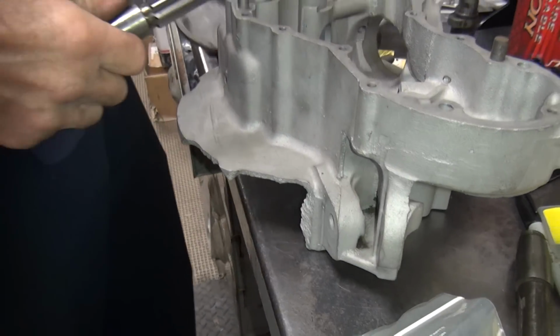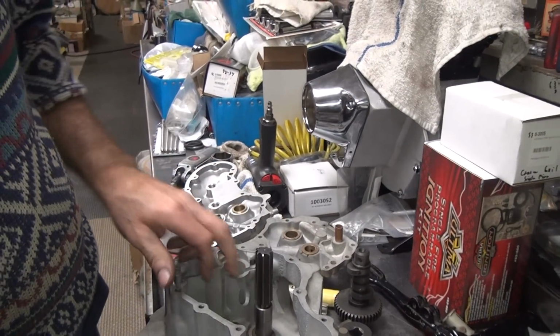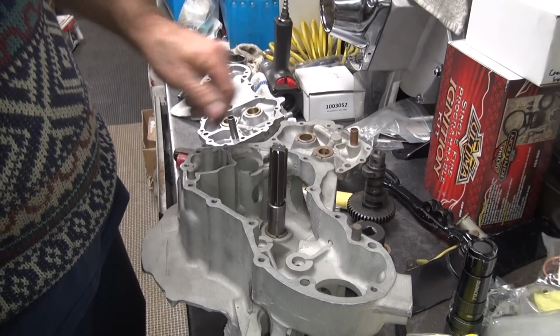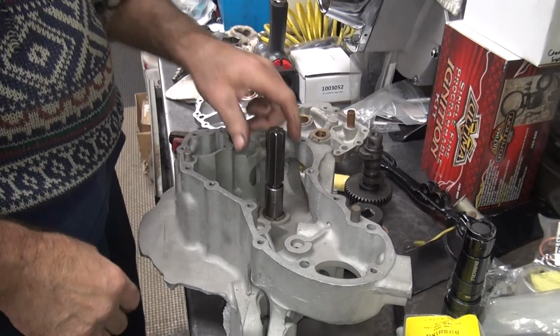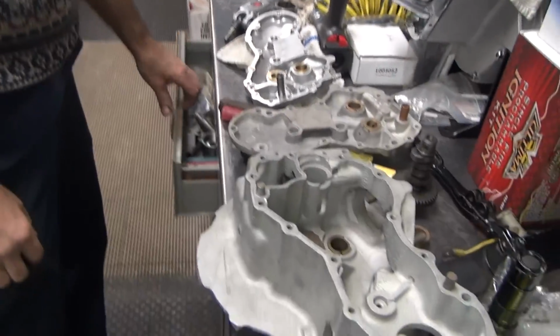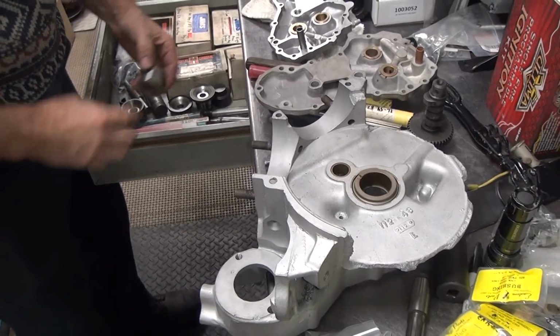The whole bottom of that's gone. Yeah, but it works very good for alignment. See, I made that bushing. Press it on the reamer. So now I have a line reamer. Jim's doesn't make these tools. Next one is we need one for the case. Go in here and find one that fits the Harley case.